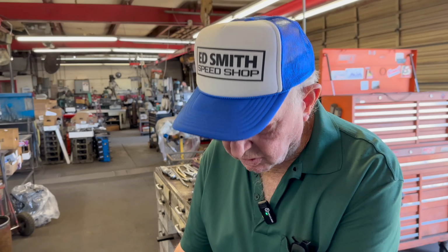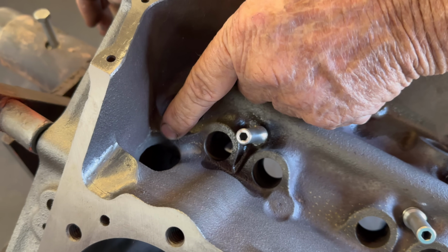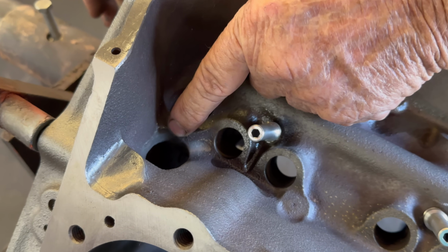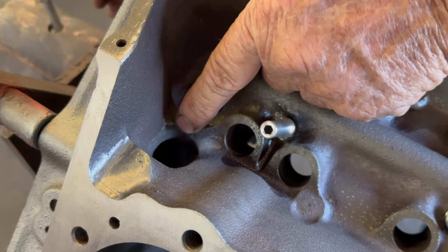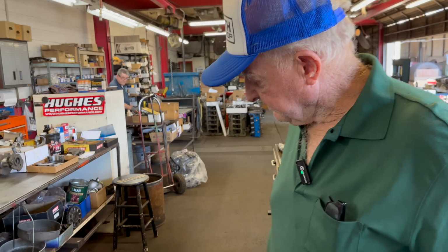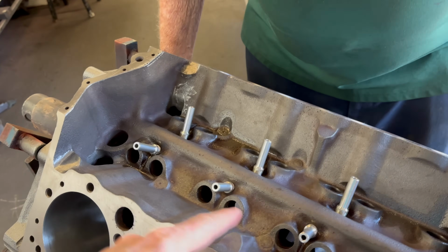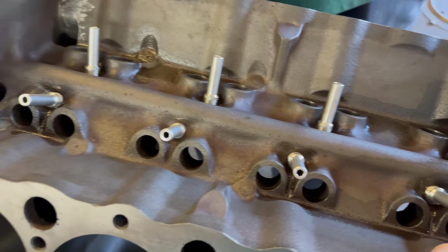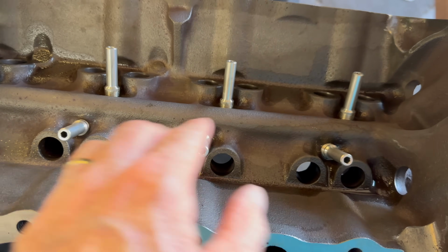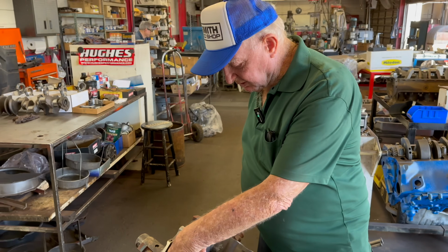It's very easy to take a grinder and just spend a couple minutes and make these holes. They're as big as a mouse. A rat would almost go through that hole. Okay. So as you're going around the track, the oil goes to the back and all goes down that hole. Okay. And no restrictions at all. Okay. Yeah. So just so I don't misunderstand, it's okay if the oil goes through here or to the timing, but you don't want it going down to the crank. Down the crank. Okay. Right. Yeah. Got it. Okay. So the oil goes down to this hole here.